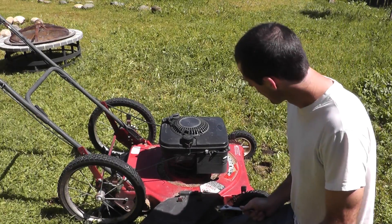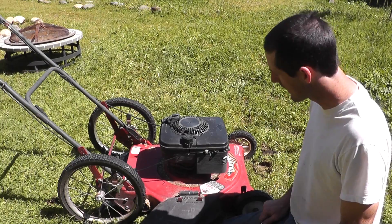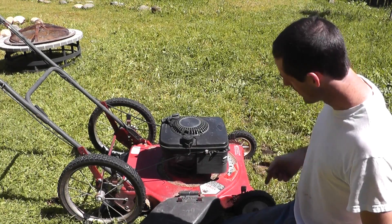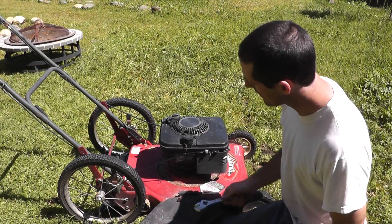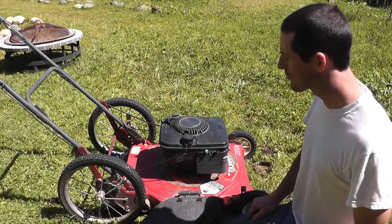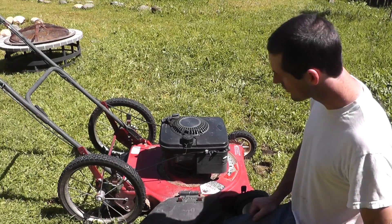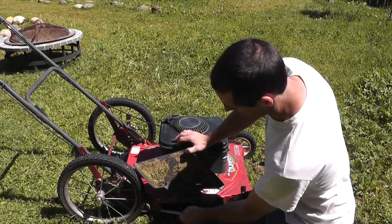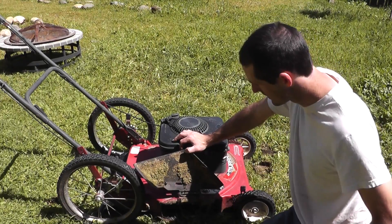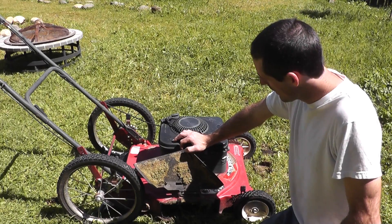Now this is a Murray Tallboy mower with a Briggs and Stratton motor, and these modifications — cleaning up the grass over the deck, thinking about changing the oil, sharpening the blade — those really help it to mow better. In addition to that, a few seasons ago I went ahead and enlarged the chute here so the grass wouldn't get stuck. If you're interested in that exciting episode you can check that out right here.